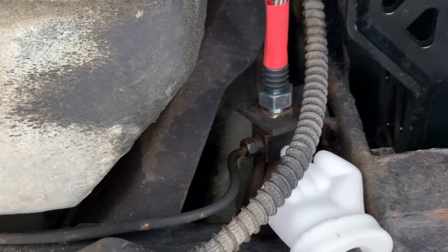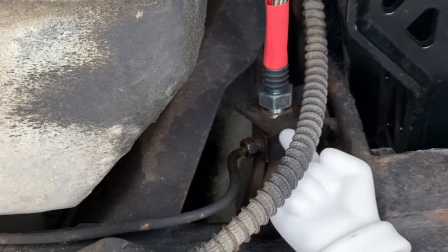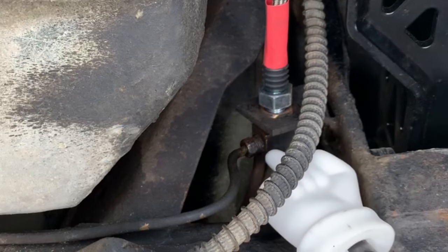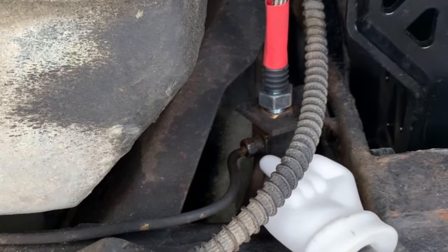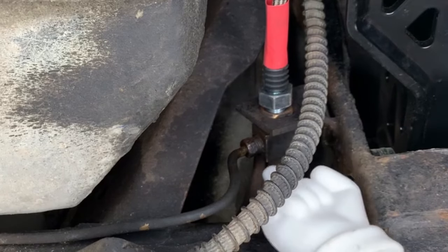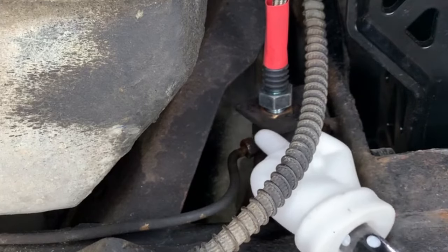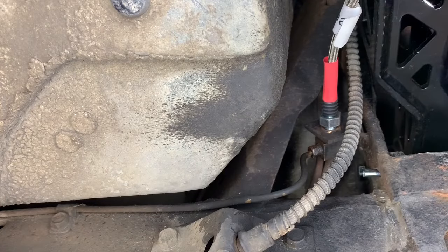And then it dawned on me that those flats weren't engaged. So then I was able to pull this back, but I had to twist it back the 90 degrees to get it to go back in there. And probably twisting it back caused it, wherever it kinked in here, to open up. So this is where my leak is. So I need this line here that goes from this side, it travels all the way across to the other side. I need a new one of those lines. I could try to patch it right here, but I kind of like the idea of getting a bunch of new lines in here. So I raised the Corvette up and we're going to put a new line on it.